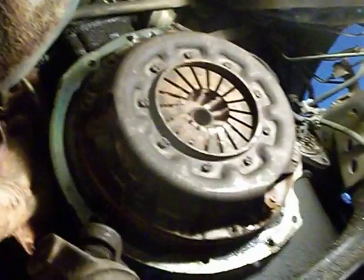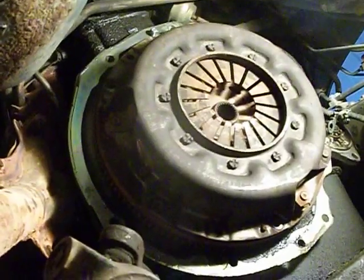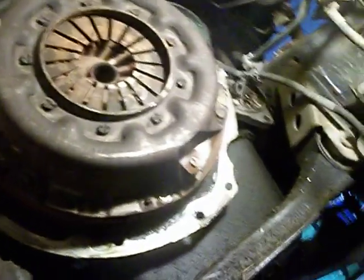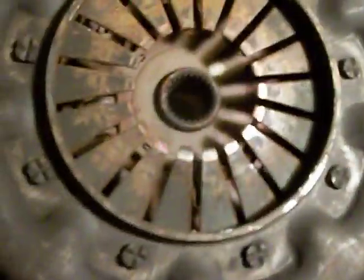So we're going to come under here, show you what you're looking at on a four-wheel drive. So crawl under here. Hey, we got all kinds of room in here now. Look at that. Alright, so we get up here, and that's what you're looking at. That is the clutch. But before you do all this, take it to the mechanic that knows what they're doing. I've stabbed about 2 transmissions, and that's what they call stabbing. You got to line this up with that one tool, then you got to stab the front of that transmission right there.